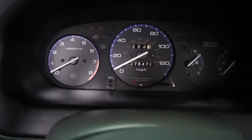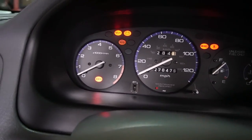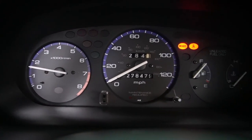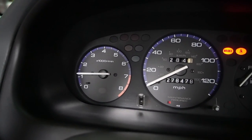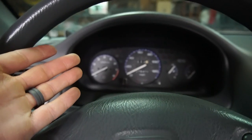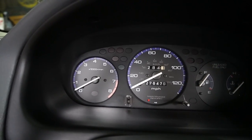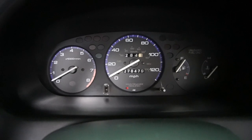And just like that, you are done — and there you guys have it. There is the official tutorial on how to install a tach cluster. There's the tach — works perfect. Fuel gauge works. I haven't driven it yet so I'm just going to assume the speedometer and coolant temp work too. That's how simple it is to get a tachometer in your base model CX Civic. Even with filming this it probably only took me 30 minutes; if you're just getting after it, you could do this in 15 to 20 minutes. You really just need a Phillips head, maybe a flathead.